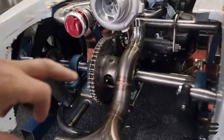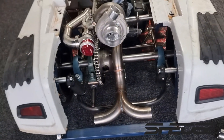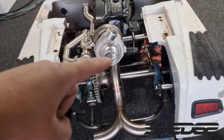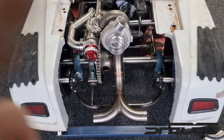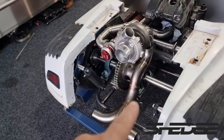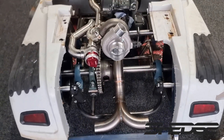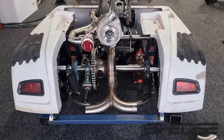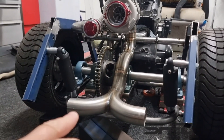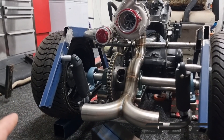Starting to take shape now. We just need to join the downpipe off the turbo to the rest of the exhaust. Since I was going to a twin exhaust I thought I'd try to hide as much as I can out the back, so looking from this angle you can't see the ugly hanger bearing or that pipe the hanger bearing sits on. So there we have it - looking nice and symmetrical. The downpipe side is all welded up and we'll leave the rest of the exhaust until later when we decide if we're going to run two small resonators or what.